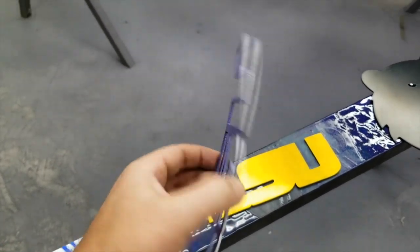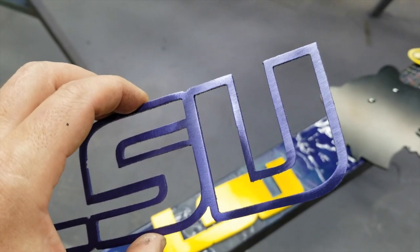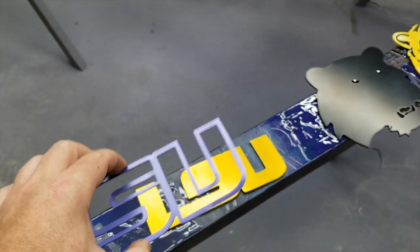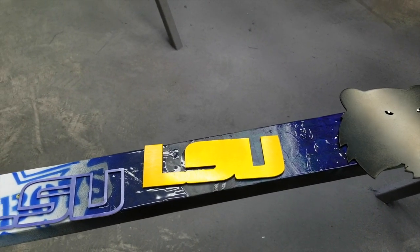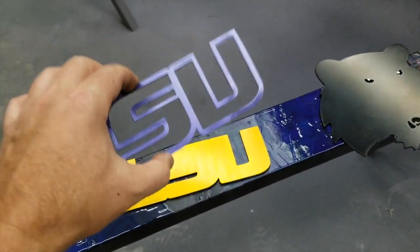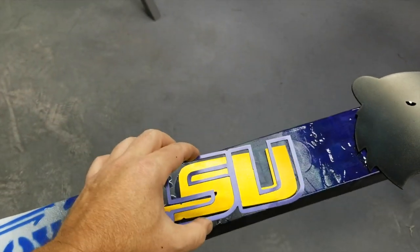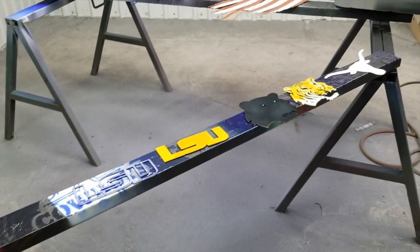But in this particular case, we want a bridge — a controlled bridge. I'm gonna come back to show you how to do this so we don't have to worry about mounting this in some kind of way, because it's so thin around the edge there's nothing really you could do. You could try to epoxy it but epoxy is gonna run out from under the edge and you'll be able to see it. So I'm gonna dust a light coat of clear on there to get a little wet bed, set this down in the wet clear, and then the whole thing will get cleared together — that will bridge all around the insides of the letters. Trust me, you will never get that off; it will never come loose, it'll all be embedded in one coat.